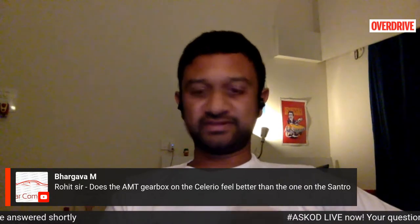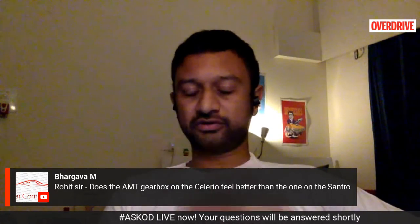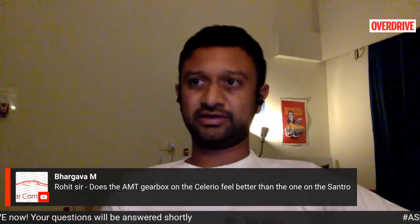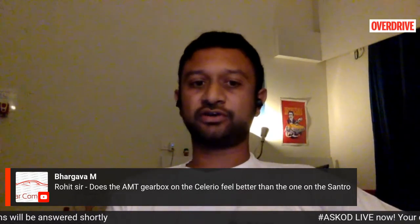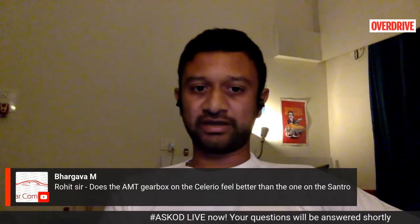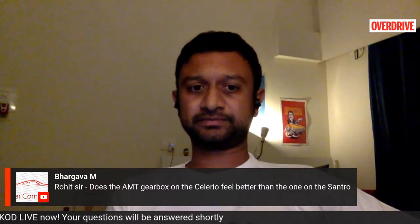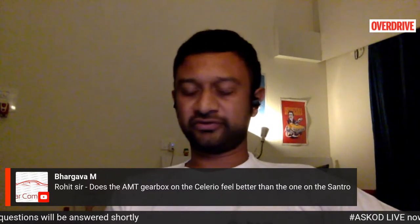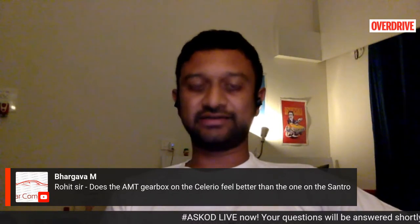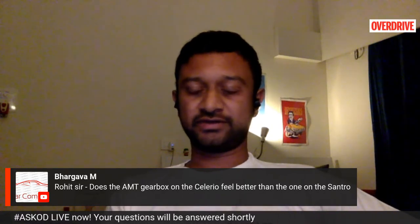So when we first tested the Santro, the AMT gearbox felt like an evolution of what the AMTs that we had tried before. Again, it was a brand new car, around 1,000 kilometers on the clock. It felt very nice. As the mileage got piled on, and with the different sorts of driving styles that we had one as a long-term on overdrive, the performance of the AMT started to slip, literally. So you could feel and hear a little bit of the slip at low revs.